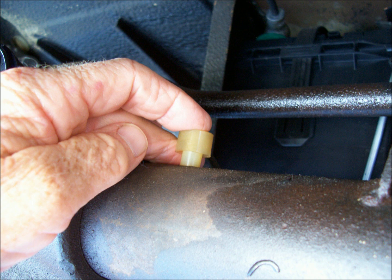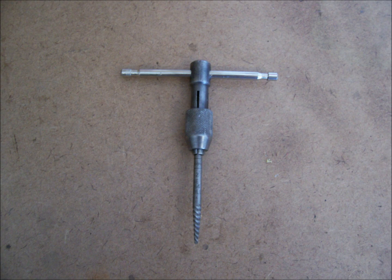I have seen posts online from MGB owners reporting that the axle vent on their car was broken off. This may have been caused by a tow truck operator who threw a strap over the rear axle and broke the top of the tube off as he tightened down the strap. This procedure can also crush the rear brake lines that run along the axle.